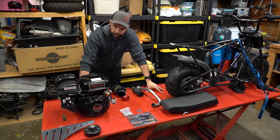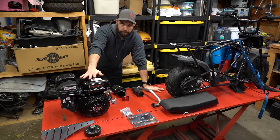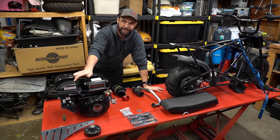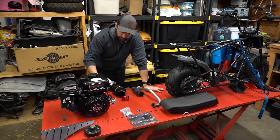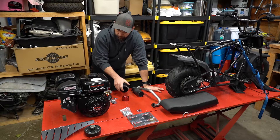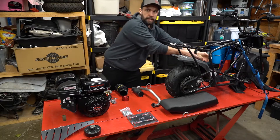Well, I was mistaken — I forgot that I had ordered a new carburetor for this thing and it wasn't going to be in time for that repair job, so that's the one that came in later. Anyways, that one's going to come off and it'll just be a spare carburetor for now because this one's already jetted for stage one. I am going to go ahead and get the carburetor on there — I just won't put the filter on yet because I've got to do the vents, which should be easier to do now than when it's crammed in.